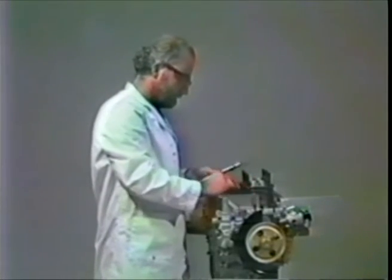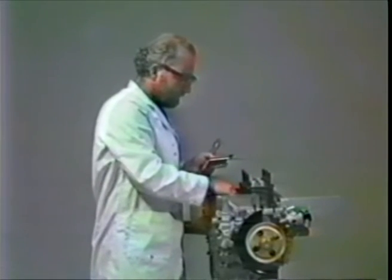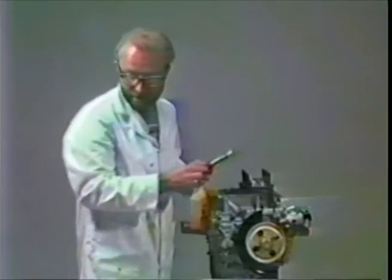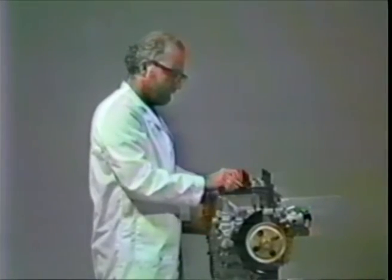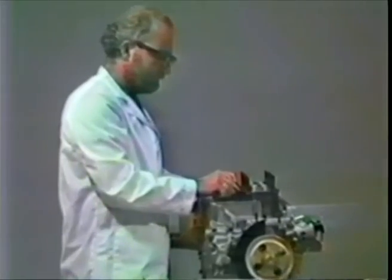And sometimes you'll find that the case washer will actually touch this edge here, which it's doing in this situation. In that case, take a mill file and just give it a few little touches like that. Do it on both sides. And that will allow it not to touch the washer and to rest a little flatter. You don't want this air deflector to protrude above the side of the cylinder. It may hit the head and prevent the head from sealing right, though I've never really seen that happen.